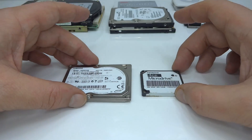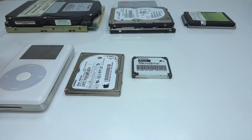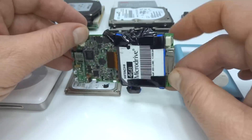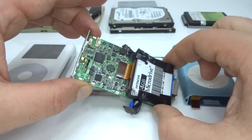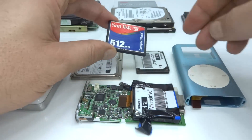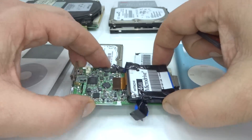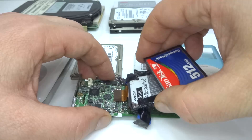There's an Apple logo on this one, which gives away where it came from. When Apple wanted to shrink their iPod down further, they made the iPod Mini, which is a bit smaller — this one has been taken apart already. So here we have the iPod Mini internals, and we can see where Apple fitted the micro drive. What's interesting about this format is that it is basically a compact flash card. Compact flash originally started as a flash memory format and then later moved into the mechanical spinning format, which meant if you had one of these iPod Minis, you could simply buy a compact flash card and replace the spinning hard drive with flash memory.